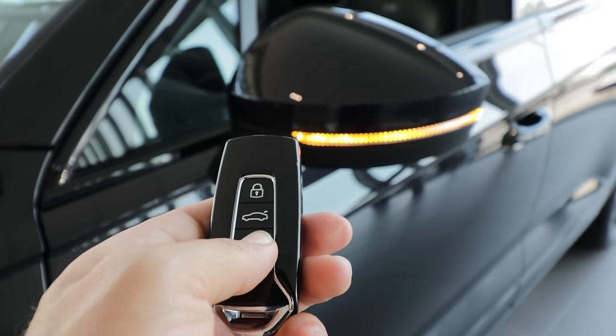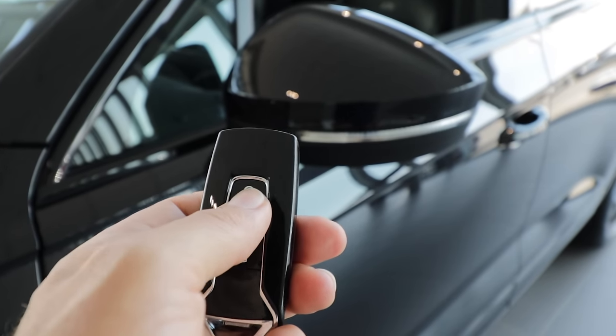The CC1101 is a sub-gigahertz chip that can send and receive sub-gigahertz frequencies. That means the CAN Commander can actually read things from your key fob and connect it directly to the CAN bus information. Not only can the CAN Commander read your key sending an unlock signal, it also reads what the unlock signal does inside the car's computer. Since we're connected directly to the computer and know exactly what the computer is doing when you press a button on the key, it pretty much gets rid of any of the rolling code problems you'd have if you were just trying to interface with the key.